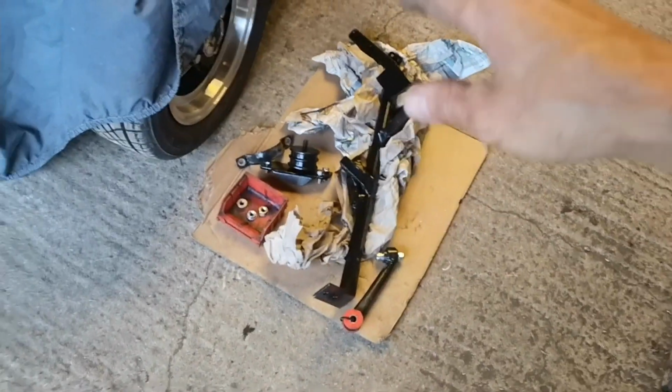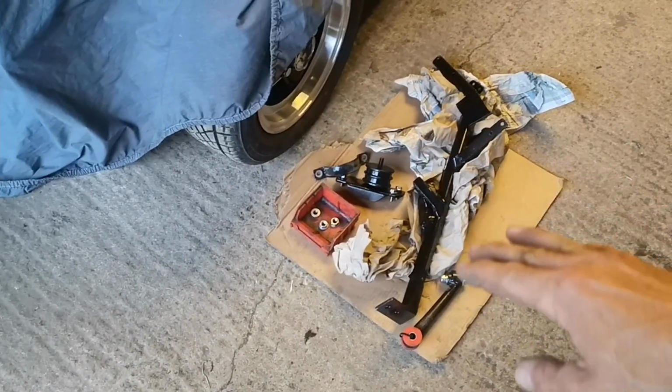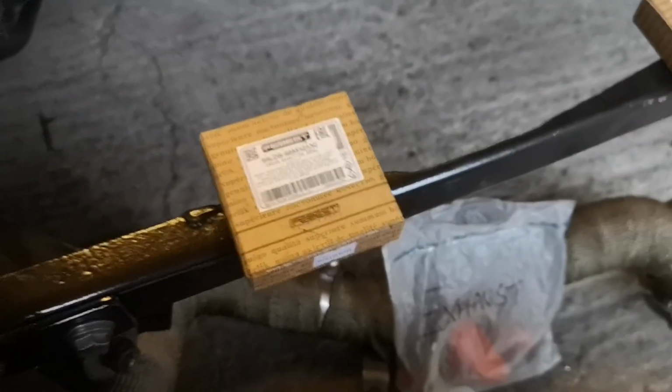So we've got the beast flipped around, lots of room still. We're prepping for engine fitment tomorrow, so there's a couple of last minute checks, checking we have the brackets. This is the side bracket here, and the brace, and the lower engine mount, top engine mount on the gearbox side, and under here we've just got things sort of out of the way. And as a reminder, we've got the downpipe and the drive shaft seals. We're going to do the drive shaft seals just before we pop the engine in. Obviously we're not going to be able to do that when they're in there.